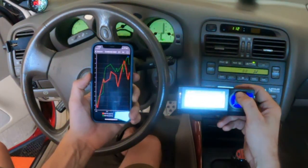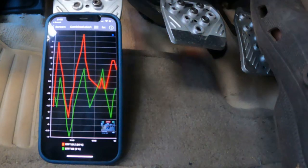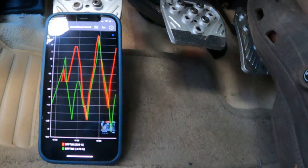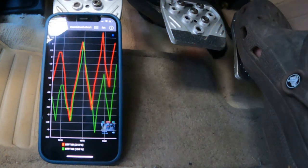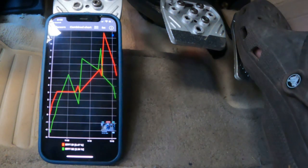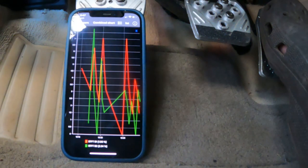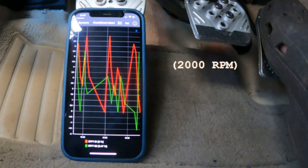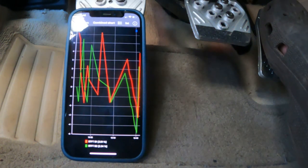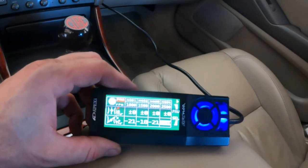I took a little too much away so I'm going to add a little bit back and see if I can level it off. Shooting for zero. At idle — 1000 RPM low setting on the Neo — it's looking fantastic. You can then put your foot on the gas, get it up to 1500 RPM and watch. Give it a second to catch up and stabilize — running a little high positive there, minus 21 at 1500, which is a lot better. Last one is 2500 RPM — looks really good. And 3000 RPM is zero, which is a hard stop.